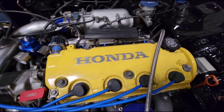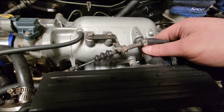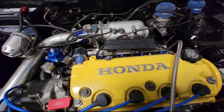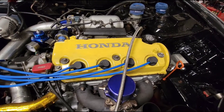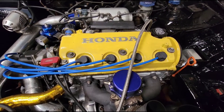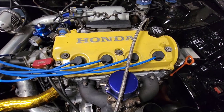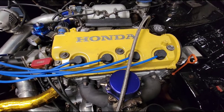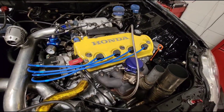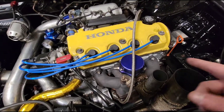What we're ultimately going to do is cap it on the intake side and leave it vented out. You don't want to cap it on the block or the head because you want to keep the vent open. This is a big thing on K-series — a lot of guys will just block it off and cap it, but that's where your catch can would go. You want a catch can because any excess boost pressure that gets through the piston rings needs to escape somewhere. If you cap it off, you're pressurizing your block even more, which can blow out your oil pan gasket. I've even seen cases so bad it starts pushing out the front and rear main seal.